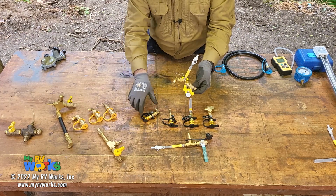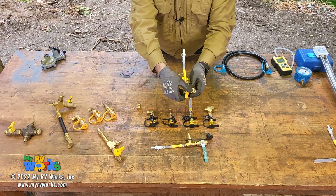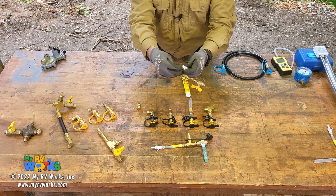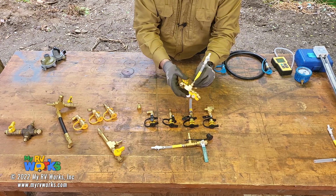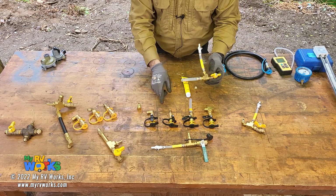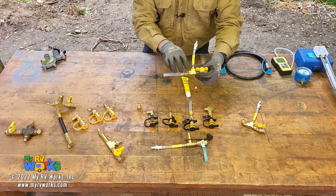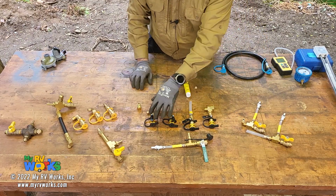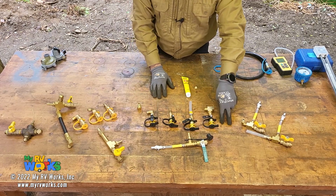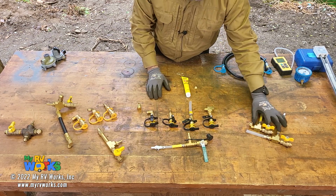Okay. You have your number 41 hole, which is industry standard. And then here we have our gas valve to turn it on and off. And then here the manometer has a quick connect on the top. Okay. And so I've got this as a standalone. And then here was another one that I made for the stove pressure drop test. So I made it a standalone. And all of these, in fact, are going to become standalones. So here we have our quick disconnect. There's one more quick disconnect that goes here. And they're all going to be quick disconnect, but they're also all going to be standalone.